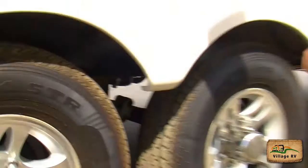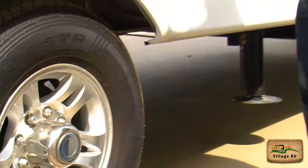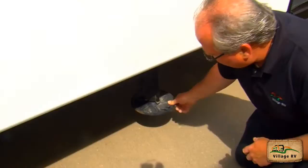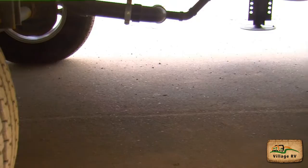This tire has lots of tread with no cracks in the sidewall or rim. I checked my lug nuts and air pressure — it's good. Water heater door is closed and secure. Side windows are all closed and secure. My landing jack here is secure. Looking underneath the trailer on this side, suspension is good, no loose wires hanging — everything looks good.